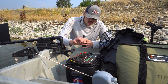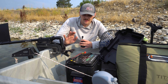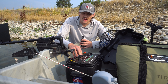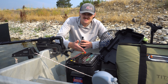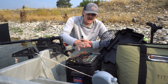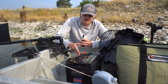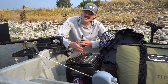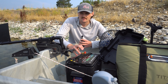The company is Amped Outdoors — they were kind enough to work with me on some videos, and they are cream of the crop for lithium batteries. This has been one of the best purchases I have ever made. I can also use this in the future if I upgrade boats — this thing could last 15 to 20 years, so I made it more of an investment. You don't have to go with 160 amp hour; I think you could easily do a 100 amp hour for most fishing days, or even 50 to 80 if you're just bass fishing ponds. In my case I'm on some of the biggest lakes in Idaho trolling all day, potentially two or three days in a row, so I need that extra oomph.